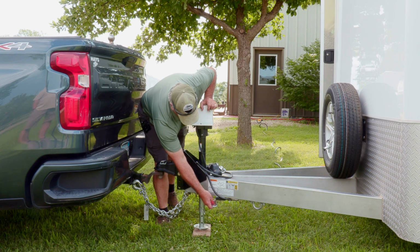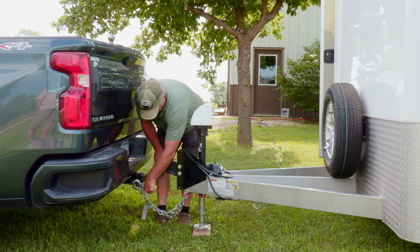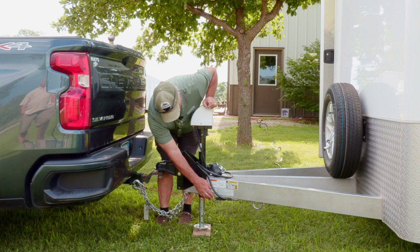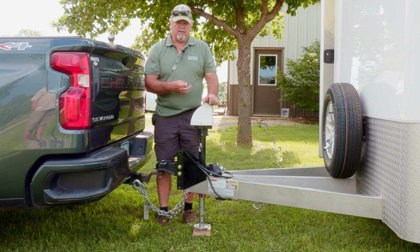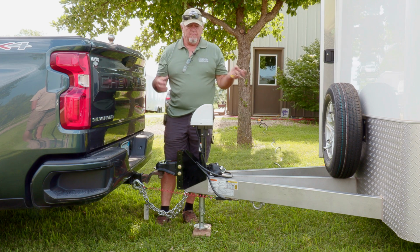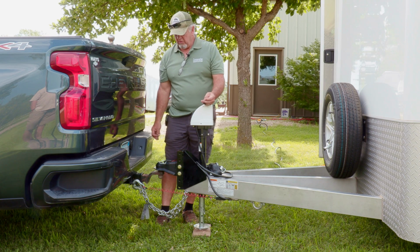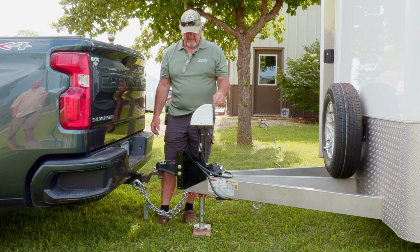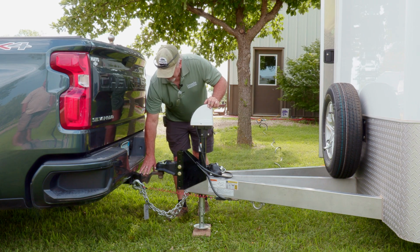The last thing we're going to hook up is a battery backup safety brake, and that hooks to a switch under the hitch here. When that is pulled loose, that locks the brakes up on the trailer, so if it completely comes loose, comes off the chains, then that would lock that up rather than the trailer careening off into the other traffic or something on that order. That would stop the trailer in place and cause the least amount of damage. That's your basic hookup for the trailer.